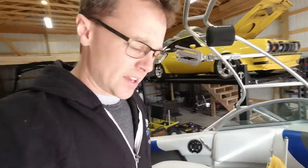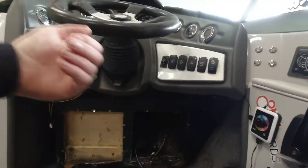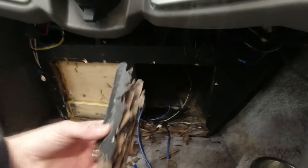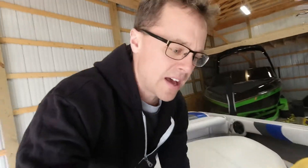Right now I am figuring out why the blower stopped working. I have to pull the sub box out, but I discovered that the sub box got pretty wet and plywood doesn't like water. It was covered in fiberglass at some point. So I'm going to rip this sub box out, get to the blower and the heater to see if I can figure out why they aren't working, fix them, and then build a new sub box. Probably not all today — hopefully I can get the blower and heater out and order the pieces we need.